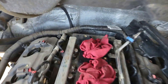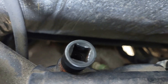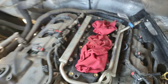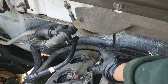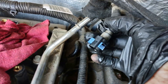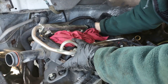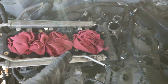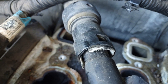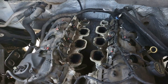There are two more bolts on the other side — there's one right there and that's the other one. This intake manifold also has a hose and a fuel line lock. To disconnect it, push from this side and it comes out on the other side. That's the intake manifold out, and that's the hose with the quick disconnect clip — squeeze it and pull out the hose.